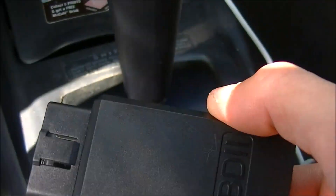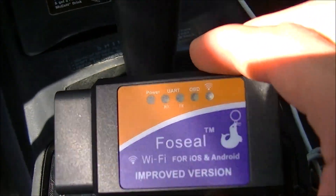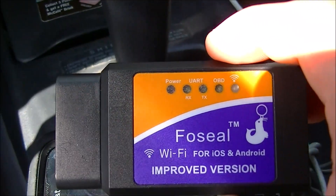It's a pretty useful tool. If you're not all that knowledgeable about cars, this little tool here can give you quite a bit of information. The only thing is it won't help you if you have a car from 1996 or before. I'm glad I could give you a brief look of the whole OBD2 Wi-Fi system. This is nice and useful if you're tech-savvy but not a car person. This is also like a code reader but it's a direct connection — it's kind of dummy-proof but it won't give you as many options. Both of these do have the capability of clearing codes, but if the car sees a fault in the system and you clear it, the fault code will just come right back. I never understood why people consistently clear the codes, but that's beyond my knowledge.